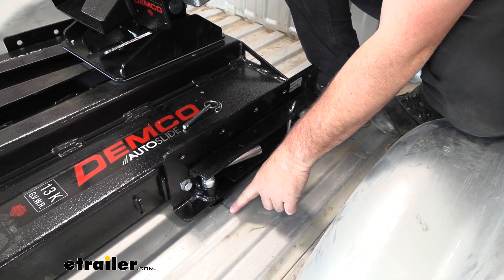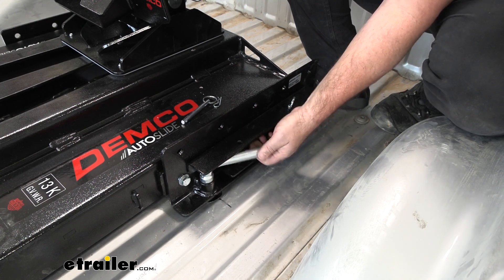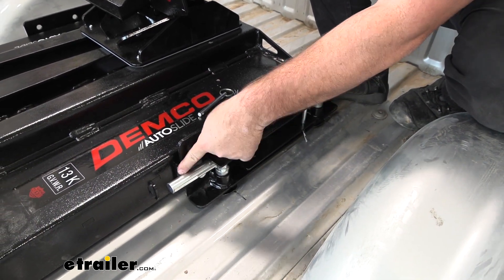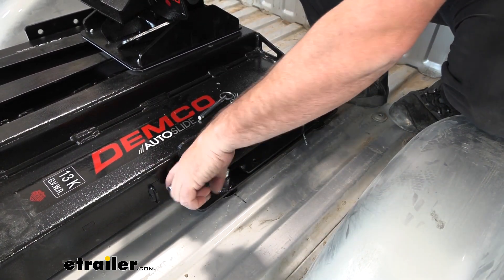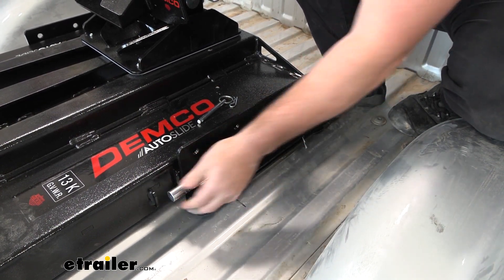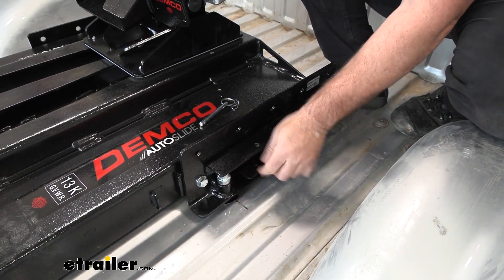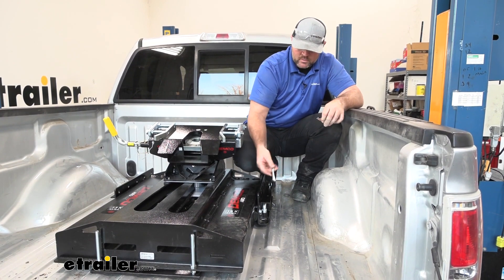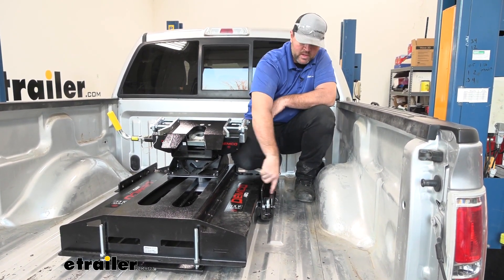Each rail that runs underneath the bed has a hole in it. Inside of that hole there's a pin that runs lengthwise, front to back. On the hitch, it has locking pins — one in front and one in back on each side. You'll notice on the handle it's going to say 'unlock,' so when it's out like this, it's unlocked. That's going to allow you to lift the base out of the truck and remove it. When it locks, in the bottom of this pin there's actually a groove and a flat spot. When it's unlocked, that flat spot slides past that pin. When you turn it, that pin actually fits inside that groove and that's what locks the hitch down to the bed of the truck. Once your hitch is locked down, it's going to have a pin and clip that slides right through this plate and clips down at the bottom, keeping your handle from accidentally coming unlocked.